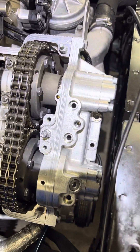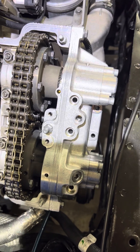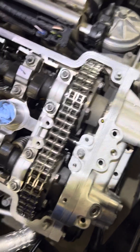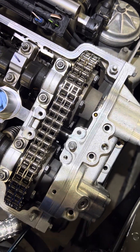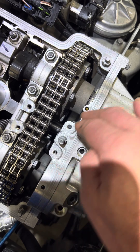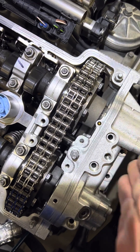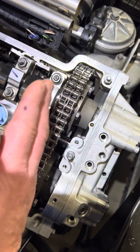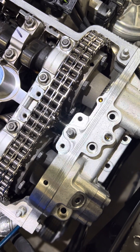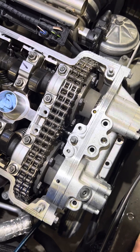Because of the clearance, it's very difficult to find a way on this car to verify the pistons are backed out in the bore. One way I started to do it was with the teeth way out for the spline shafts, tighten one of the bolts, connect the pistons to the spline shafts, and then push the Vanos forward. In theory, the tight hubs would push the Vanos pistons all the way back in the bore as it goes forward. But in reality, because of the clearance and just the way stuff moves around, at least for me, it got very close but the pistons would not go all the way back in the bore that way.